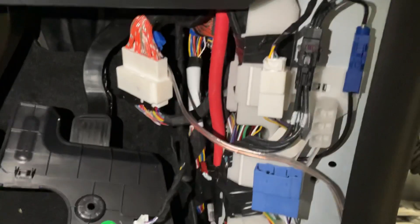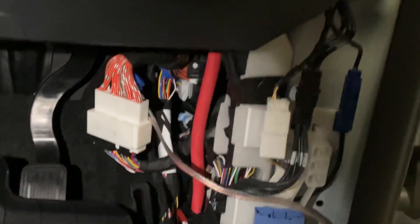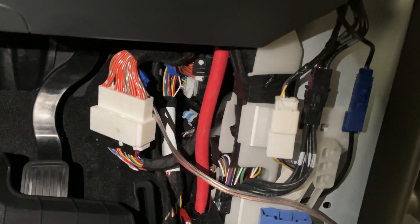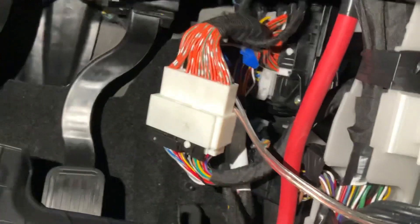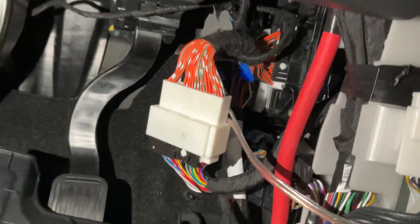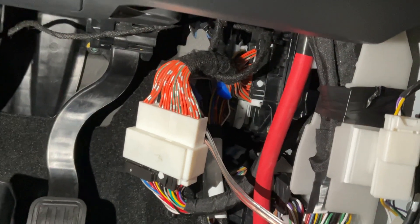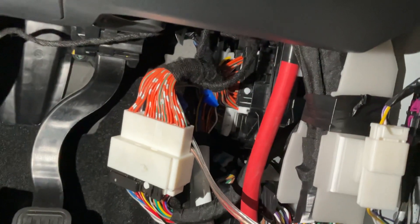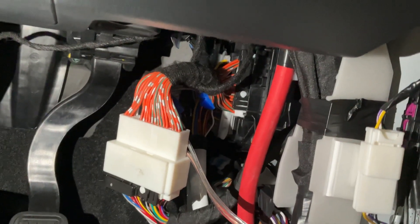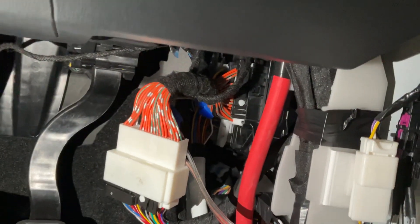The colours for tapping down here are a little different in the 2021 version. This took me a little while to find out and to verify. You're looking for brown and grey, and they're also in a different position on the connector compared to the 2020 versions — that stumped me for a little bit when I was trying to verify the connections. The wires are at the bottom far side of the connector when it's plugged in, if that helps.